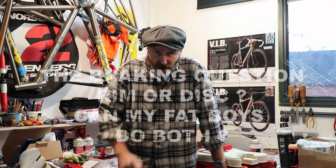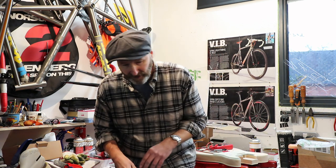One of the questions we get asked a lot — actually two types of questions — relates to disc braking versus rim braking. If you order a pair of our wheels today, you can order them with a disc hub set. This disc hub set can be set up to work with a road bike with quick release axles and rim braking, and it can also be used in a thru axle or quick release disc braking bike with the addition of a brake rotor to the hub. So these are very versatile wheels — you can ride them in road bikes, mountain bikes, 29ers, and cross bikes.